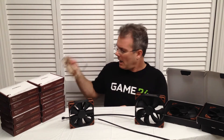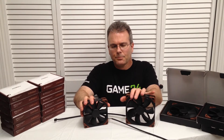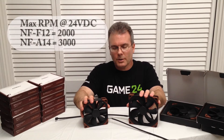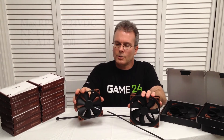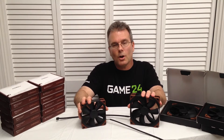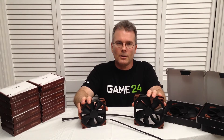It's a truly amazing fan. However, these are actually industrial PPC fans. They're made to operate at 3,000 RPMs and 24 volts. Now, they'll operate just fine on your standard 12 volts that you find in your home PCs, but they'll run a little bit slower. The smaller 120 mm fan will run at about 1,000 RPMs, and the larger 140 mm fan will run at about 1,800 RPMs.